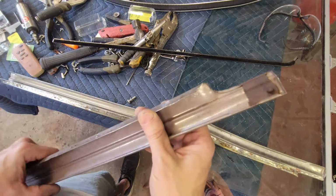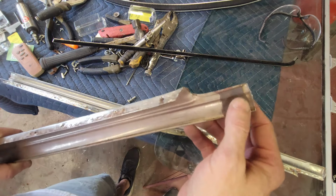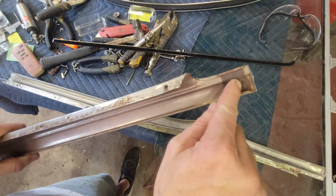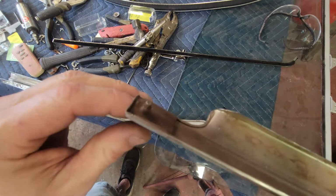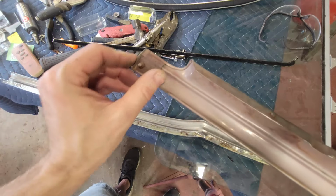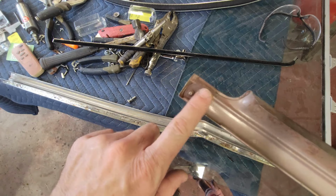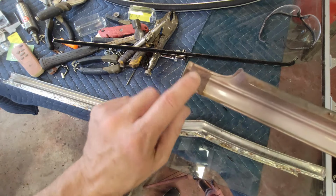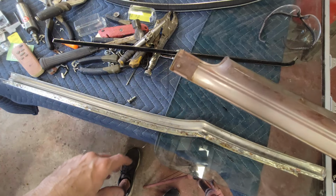But before I do that, you'll notice that it's got two steel clips on the end that have that 8-32 screw in it. And I have a rusted out screw stuck in both sides. Both sides. And the clip set does not come with this. So I've got to take these two steel pieces and I'm going to have to try to get the screw out and then pass a tap through it, and then we'll be on our way.